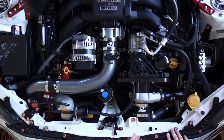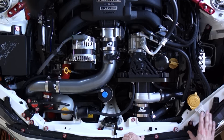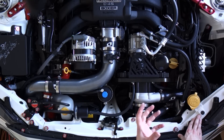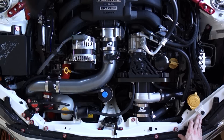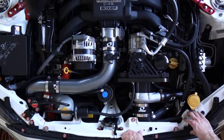The next thing to understand is a few different types of blow-off valves. You've got what you call a factory blow-off valve which is typically just a diaphragm which is spring loaded, and that works a little bit differently from a standard bypass valve. The diaphragm style valve typically tends to leak pressure over a certain amount - that's to help emissions. It also tends to close a little bit slower, again to help emissions, so you're not getting any excess fuel being burned when you're lifting off the throttle. They're not always the most efficient design because they're designed more to pass emissions rather than for performance.